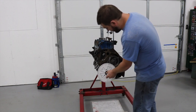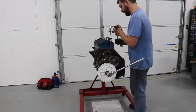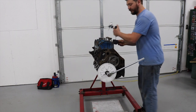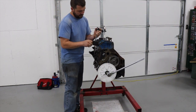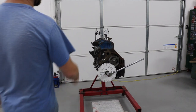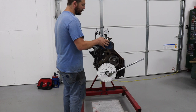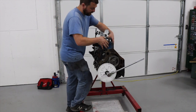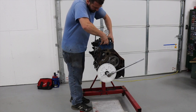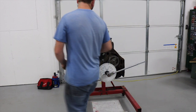The intake valve is just now opening. I'm going to set up at 15 degrees before TDC. Put your dial indicator on there, set it to zero - this spring's actually a little bit stiff to be doing this. You push straight down to the retainer, make sure your rocker doesn't hit your actual indicator. We have well over 200 thousandths piston-valve clearance. We'll go to 10 degrees, which is where people typically check it - re-zero the dial indicator.